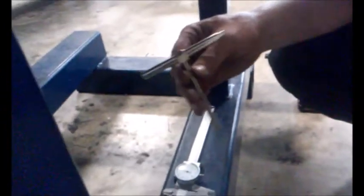Making sure it is perpendicular, tighten it, bring it out, using your gauge once again. I am not going to do it again — you have seen me do it twice. That is how you would get your measurement of the bottom of the bore.